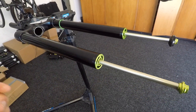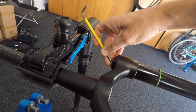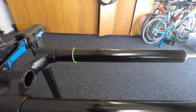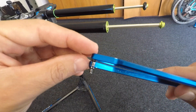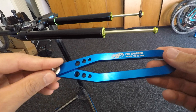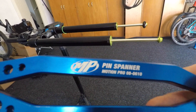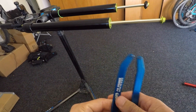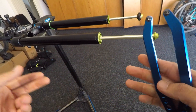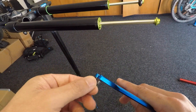We've got the lowers off because I'm building this thing up for a customer. First thing is to always check that all the air is out — you don't want to undo that when it's got air in it. To get this next part you'll need some form of pin pliers. I use this Motion Pro pin spanner — there's a code on it if you wanted to get one. It's a bit longer and has a bit more leverage. I do this quite often so it's worth investing in a proper tool, but just a pair of pin pliers or something similar will do the trick.